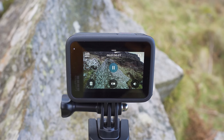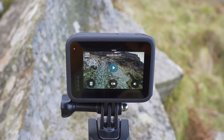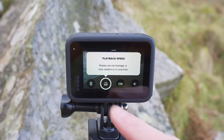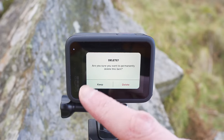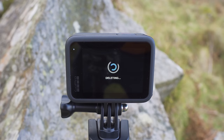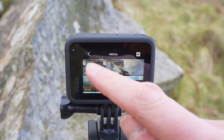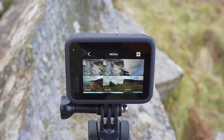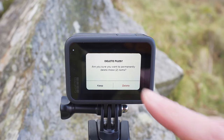On the home page, swipe up from the bottom of the screen to open the media tray. Here you can preview all your videos, images, and time lapses stored on the camera's microSD card. Scroll left or right to go through each recording, and if it's a video you can play it back by pressing the play button and pause with the pause button. If you recorded in a slow motion frame rate such as 60fps, 120fps, or 240fps, you'll see an option to slow down the playback. There's also a bin icon on the bottom left to delete individual pieces of media, and a grid icon on the top left to see thumbnail previews of all files. You can also select multiple items with the checkbox icon and delete them all at once.